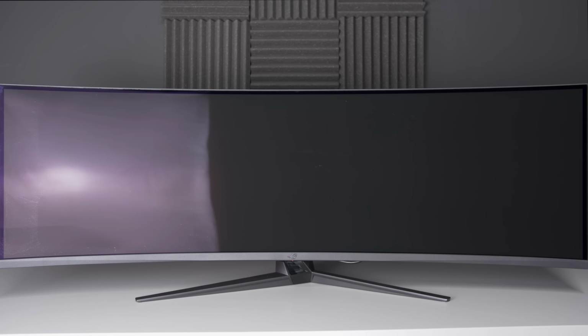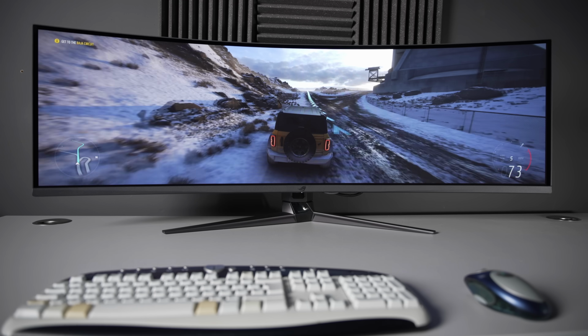Although please be mindful that because there's no polarizer on QD-OLED panels, the screen would turn gray when hit by direct light, so careful positioning of the monitor is critical to prevent a significant loss of ambient contrast in a well-lit environment.